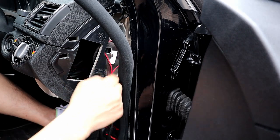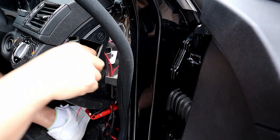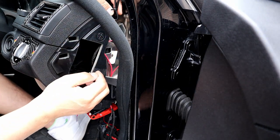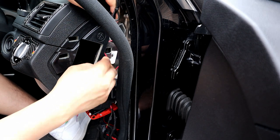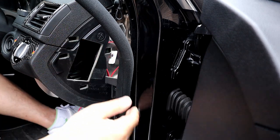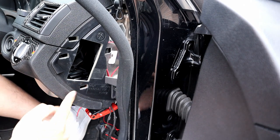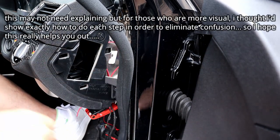If you see here, this is where the ground is for the camera. The cabling comes down — this is the power cable for the dash cam. It just runs down and I've tucked it behind this here. To remove this piece, all you have to do is use a trim removal tool, push it in between here and pry it out — it just comes off really simply.